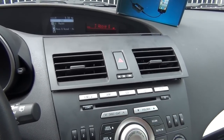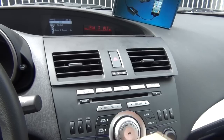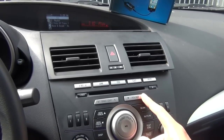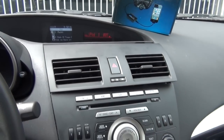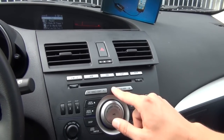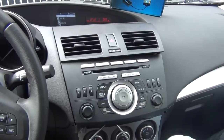You can also use the display button to choose what you want to show — playlist, artist title, album title, or song title. Pressing folder up moves through your playlists: second playlist, third playlist. If you want to get control of your iPod back, go back to iPod 1 — that's the manual mode and it unlocks it. That's pretty much it for using and controlling the iPod.